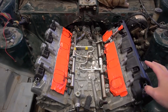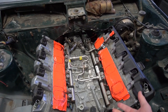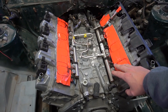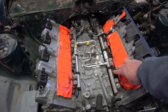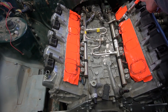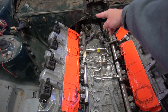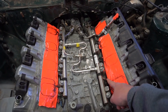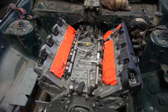The engine going into Clyde is a 2014 L83 out of a pickup. What's different on these L83s is it's a new Gen 5 LT version, similar to the LS but with some changes. The main change is direct injection — spraying fuel directly into the cylinder. You have between 40 and 70 pounds of fuel pressure coming up to the fuel rail, feeding the mechanical fuel pump in the back, which is driven off the cam, and then it feeds the hard line for 2500 PSI, which sprays directly into the cylinder. It's definitely a different design, something a lot of people have been fighting with on tuning.